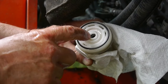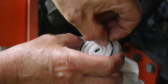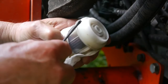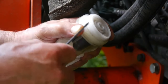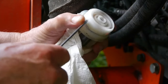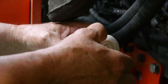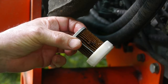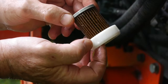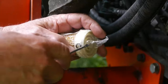Now there's a big O-ring and then in the center there's a small O-ring, so we'll take that larger O-ring out and put that aside because we're going to reuse it. Taking off this fuel filter was quite a trick — I wasn't sure if it was threaded on or just pushed down in there. It turned out I could use a little screwdriver to get it out. This fuel filter really needed to be changed — you can see the bugs in there.